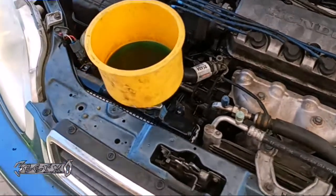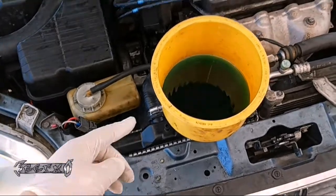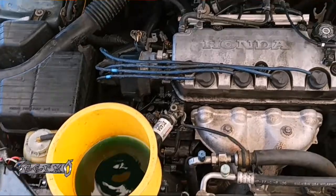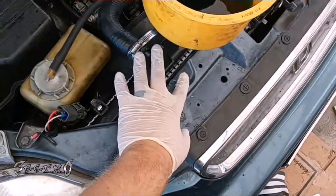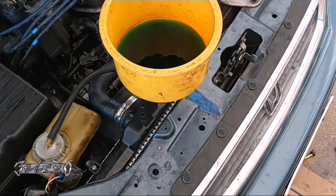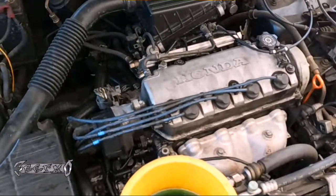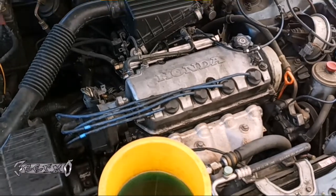I have a funnel tool that connects to the radiator opening, and I filled it with OEM Honda coolant. I'm just letting it run and fill up — any air bubbles will come out. Have the heater on because it helps circulate the coolant through the heater lines. Put the upper mount back in place. Check your leftover parts pile to make sure you didn't miss any bolts. Then take it for a test drive. That's about it — hopefully this video helped you out. Thanks for watching and I'll see you next video.